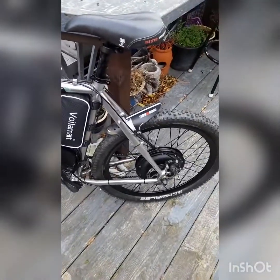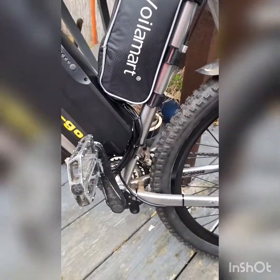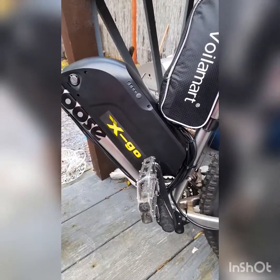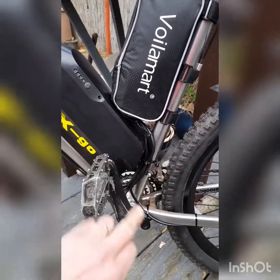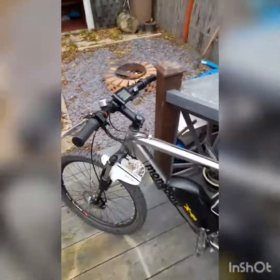That's another build done — took it out and everything works fine. If you need any more tips or have any questions, please comment, like, and subscribe if you're into this sort of thing. There's not much to these Voilamart kits — they just plug in really. The main things are mounting your back wheel with your torque arms, getting the pedal assist on with the crank tool (costs about 12 quid), getting the battery on, controller in the bag with all the wires, and then your handlebar bits like the LCD and brake cutoffs. For a customer build it's always better to do it properly for safety — until the next one.